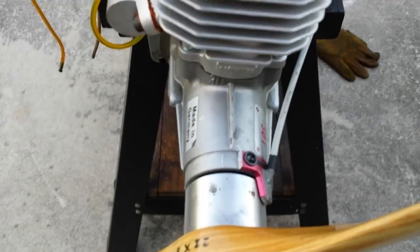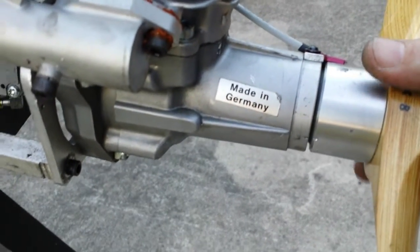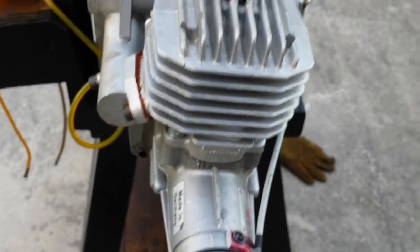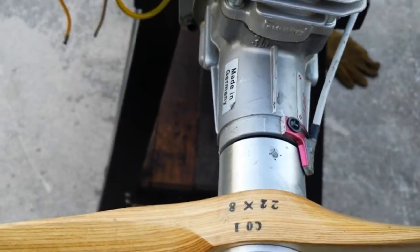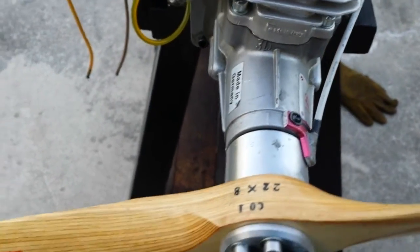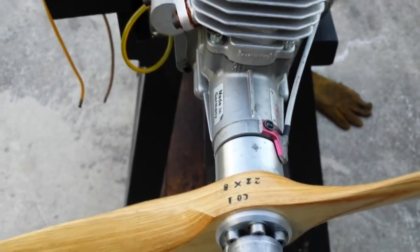The red magnet is the one for starting, and then the green one is the one that is going to keep the engine running and set the curve for the engine. 3W also made the zero mark at top dead center — it's right here, you can see it hopefully. The way you do it: you get the mark, you put the sensor on, and if you have a timing checker device, you use the four-pin sensor. At the time when the magnet gets in touch with the sensor, the green light comes on and the buzzer starts to buzz — at that time you lock it down, and that's it. Then you flip the prop after you prime it and get the engine running.